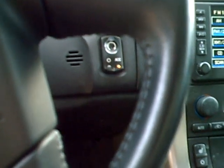First thing we have to do, as in the other videos, we have to put the ignition switch in the accessory mode — a little yellow light below ACC. I'm going to push and hold the lock and unlock buttons on the fob until we get a honk of the horn. That indicates we're in a learn mode.